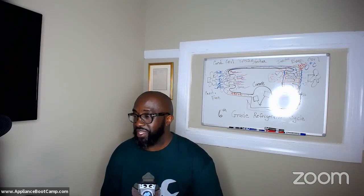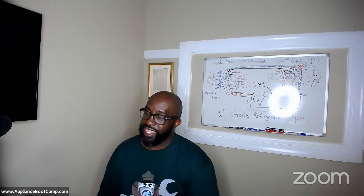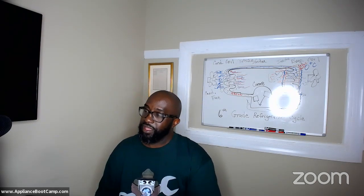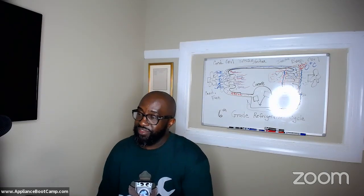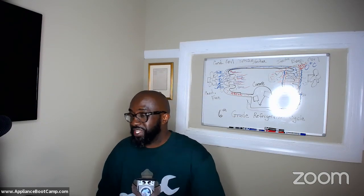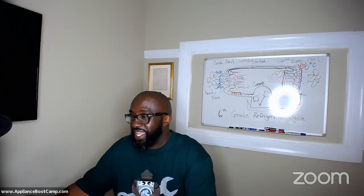Right now, with the young man that's renovating the actual building, tomorrow we're going to finish what we're doing now. I'm showing them some of the trusses in the ceiling. They were actually bad, so we had to take them out. So what we had to do was build a brace to push some of the trusses up as we reset them. And that's fun. It's something I had never done before. They had never done it before, but we did one or two of them before we quit this afternoon. And tomorrow we're going to do the rest of them and reframe them. I can't wait to get there tomorrow to start doing it.